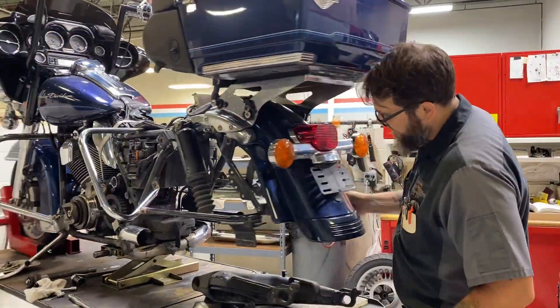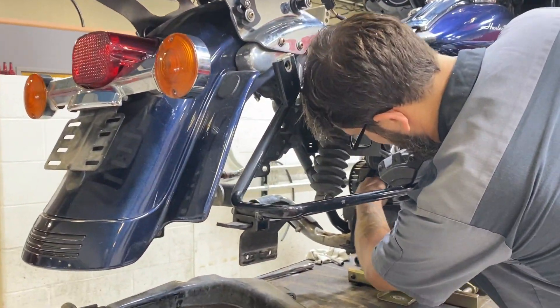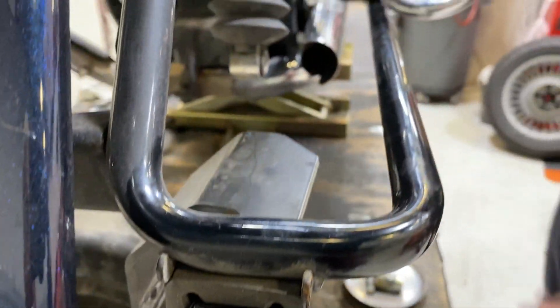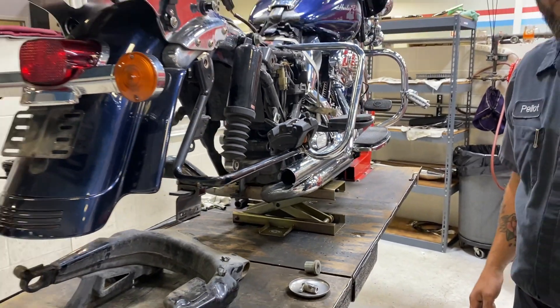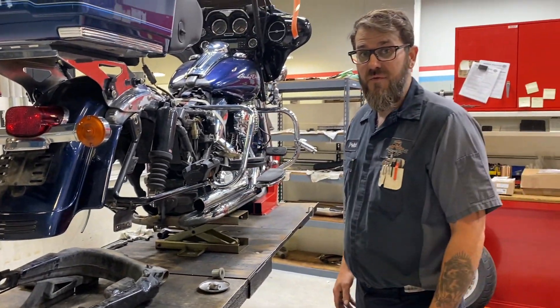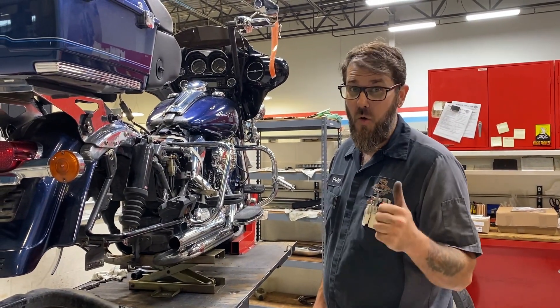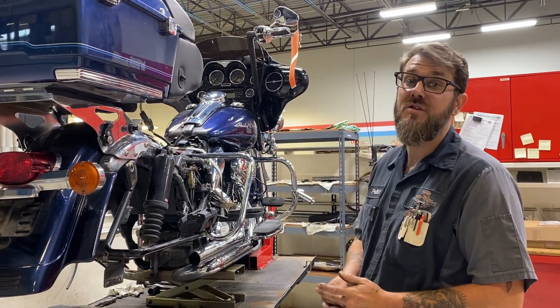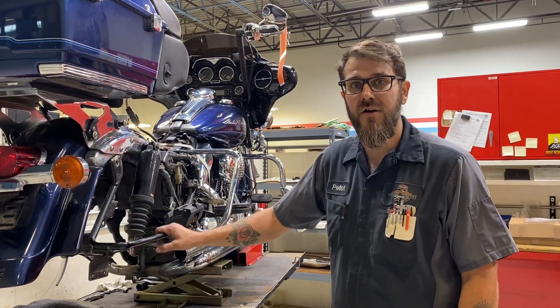As you can see, we've got debris way up in here — some of the chunks of the belt are laying up here. We were able to leave most of this together, but getting everything out of there is a bit of a pain. Again, belt drive deflection is really important — keep that tight. Make sure you do it every time you change your oil and it will last as long as you own your motorcycle, I guarantee it.